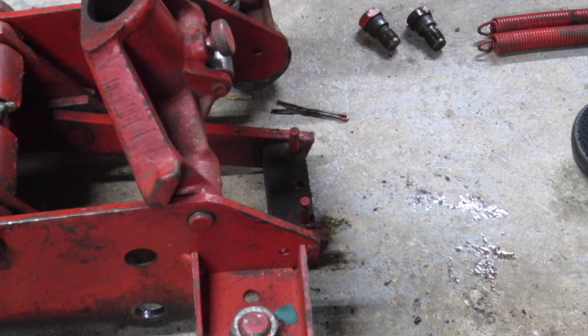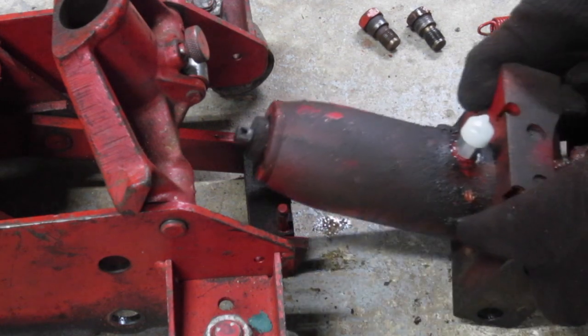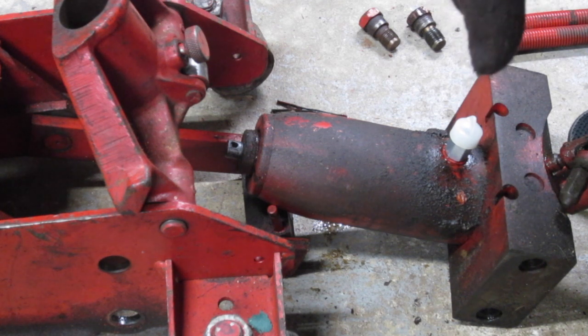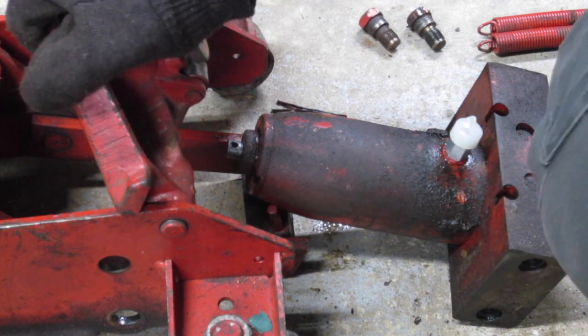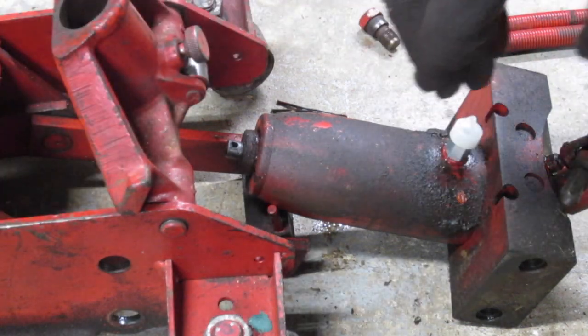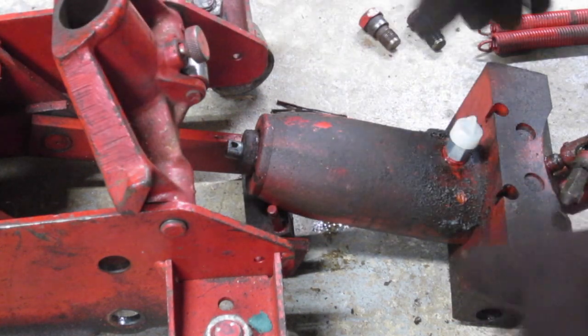The main reason I like these jacks is because they're that easy to work on. I have three Snap-ons and one Lincoln that I also have to send out to get repaired. I also have a couple of unknown imports I use occasionally — one's from Japan. The main thing with jacks is I like American steel. The ones made in the USA tend to be more heavy-duty. I've had jacks bend on me — the metal will bend when under load — so I'm very picky about the jacks I use.